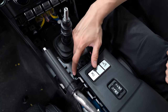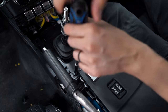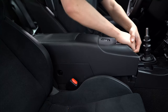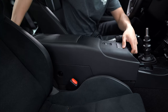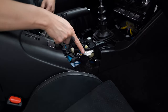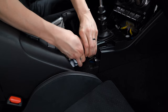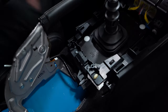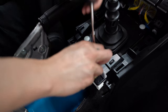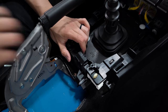The lockout gives us access to two Phillips head screws that we'll remove. That is going to free up the rear portion of the center console so we can pull up on the front side to pop it loose, as well as the back, and then slide it back and out of the way. We've got two connectors that we're going to disconnect. There are two more Phillips head screws that we'll remove.